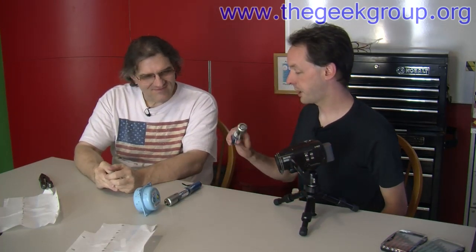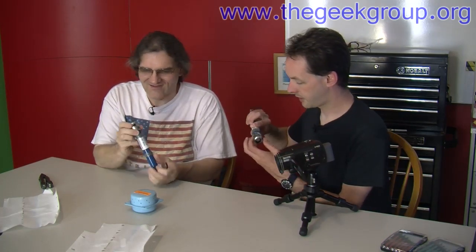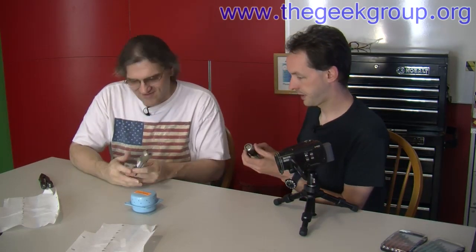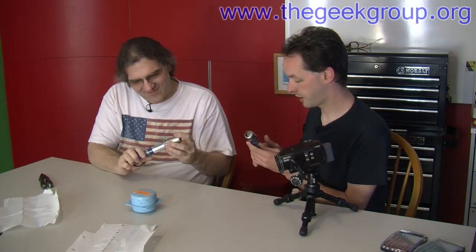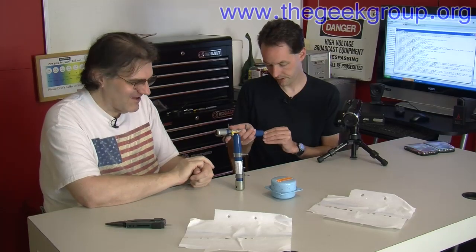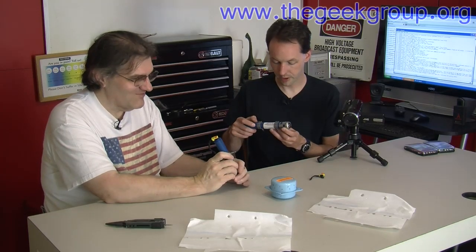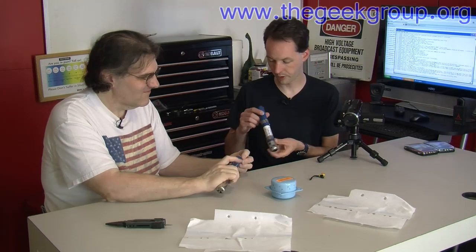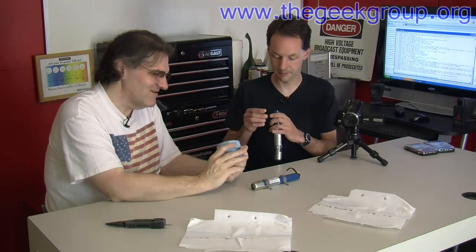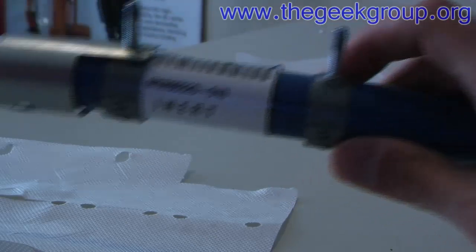That's our look inside automotive airbags. We've got knee bags and dash bags. On this one here, you've got holes around the end — these vent out here. It looks like the chemical comes out this end; there's little holes down inside there, and it has a safety guard around it. Opening this thing up would not be a trivial task. These things aren't just screwed together — that's like hacksaw territory. This is crimped. There's no way you get into these without destructive experimentation.